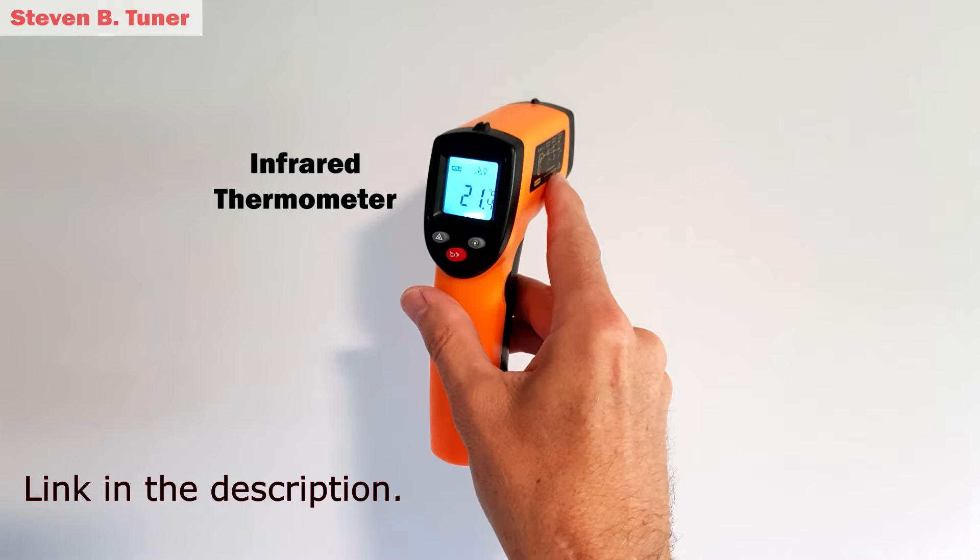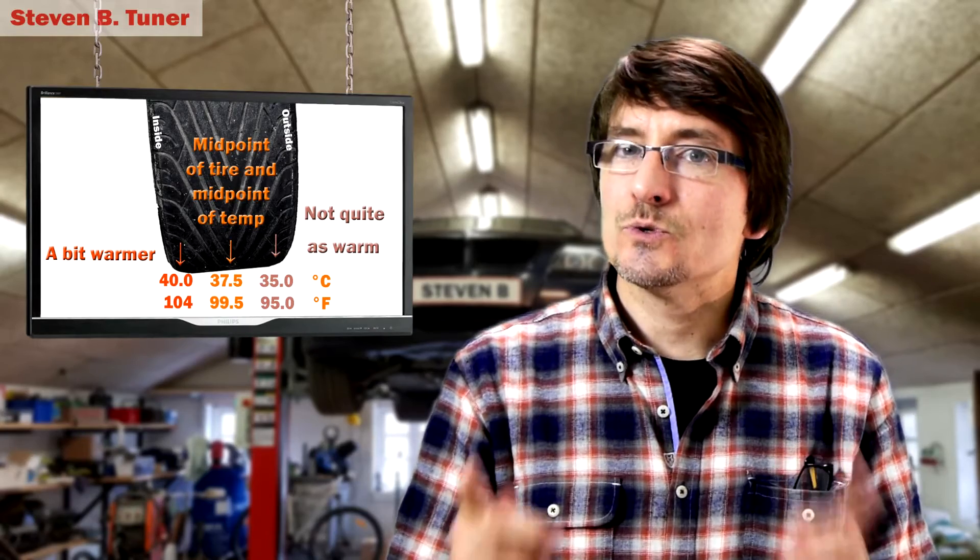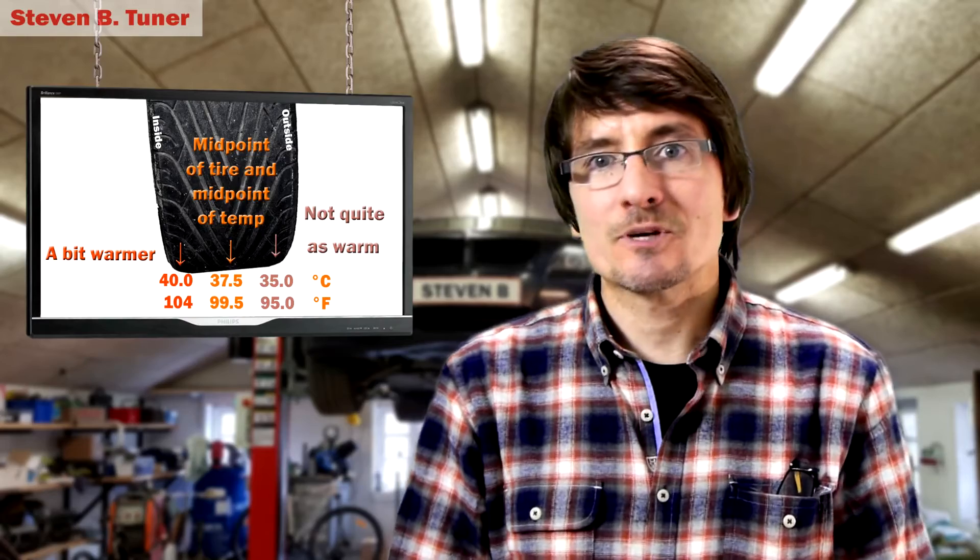And you might be thinking at this point, where's the rest of the video? What tire pressure did you hone in on? Well I'm not going to tell you. This video is about your car, your driving, your experience, your tires, your camber. So what I set my car to with my driving, with my load, is really not going to help you at all. Even if you have the same tires, the same car, the same power, the same load — you need to work this out for yourself. So it's up to you. If you haven't already got one, get yourself an infrared thermometer and get measuring. You don't even have to know what the pressure is, you just have to know that you need to add a bit or take a bit away, in order to get that center section to be right in the middle of the two outside temperatures. It's the cheapest performance upgrade you're ever going to have.